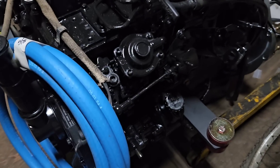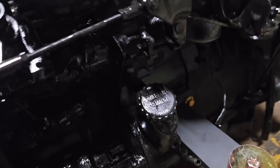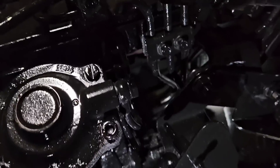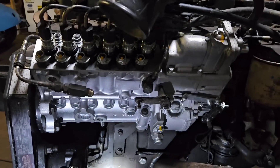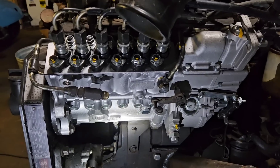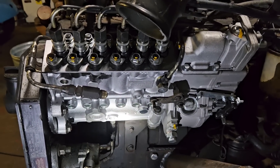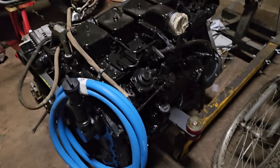The VE pumps are easy to identify — that's a VE pump. The injection lines come out the back of the pump. So all the injection lines come out the back of the pump. And then a P-pump, which is a 94 to 98, is the big dirty P7100 pump. They're more desirable for a lot of people for horsepower, but I find them a little harder starting, especially in the winter. So I prefer the VE pump model.